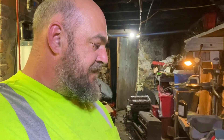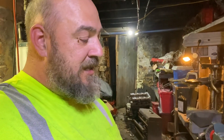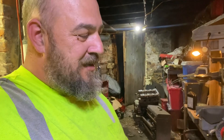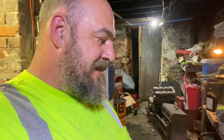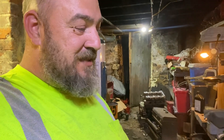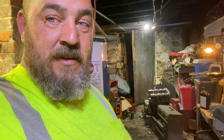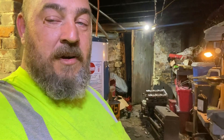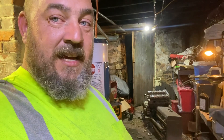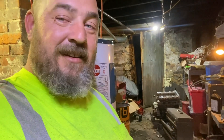So yeah, that's what she looks like right now. I've just been playing with it a little bit at a time. I got kind of bored of doing the squish adjustment and decided to start playing with that exhaust a little bit. I'm still debating on whether or not I should take it further than 30 thousandths — 25 is probably the best, but I haven't decided. The amount of time it takes to make these squish adjustments is crazy. I'll sand at it for a while, go take a measurement, and I've only adjusted one or two thousandths. Two thousandths usually at the most. I'll go back and sand for a long time and check it — maybe two thousandths. It's usually one thousandth at a time that I'm making these adjustments between measurements.